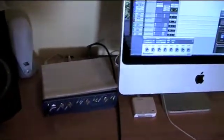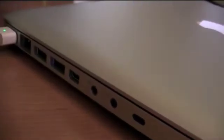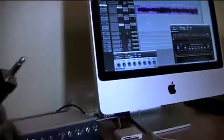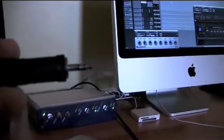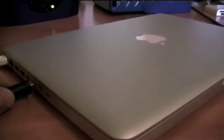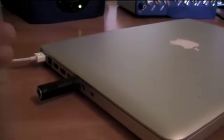If you don't have an external audio interface, you can connect to your Mac directly. On a MacBook, on the left side you have a mini jack — the one on the right is for headphones, and on the left is your input. You have to use a mono jack — one with just one black stripe — because you will not connect your guitar in stereo, otherwise you'll have no signal at all. So you plug it into the mini input, and that's the internal audio interface of the MacBook. Then you connect your guitar there.